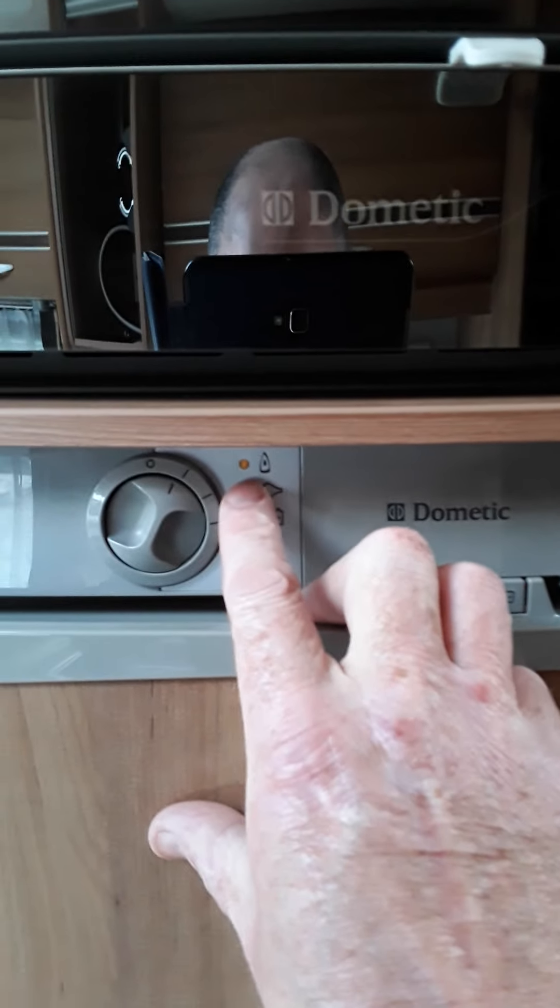Just to recap draining the van for winter: push the red valve at the back down, and open the tap between hot and cold - that's the cold position, hot position is right around, so about halfway - and make sure the pump's off. You can hear the gurgle as all the air goes out of the tap and back out through that valve at the back. When you come back to fill the van up again, pull up the red valve and open your tap on the hot position. It'll blow all the air out of the tap and eventually you get a free flow - you'll know then that your water system is back in pressure.